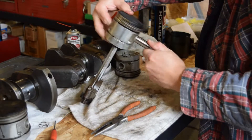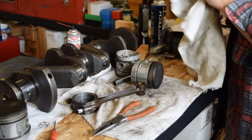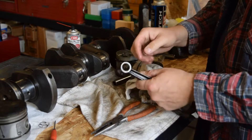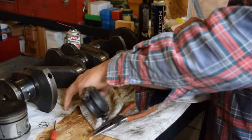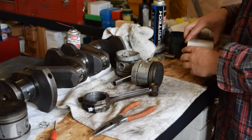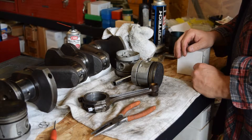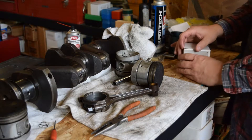The wrist pin comes out, piston comes out. What I've been doing is inspecting the bushing inside, making sure it's in good shape. We actually replaced one of these on one of the earlier ones — we don't have that on film — and it was a bear. We had to hone it to the proper size. Some people say it's okay to hone, some say you need to ream it and then hone it.